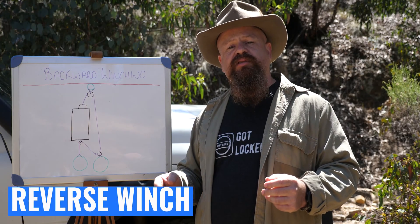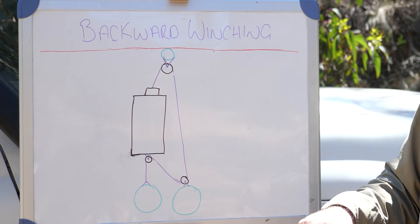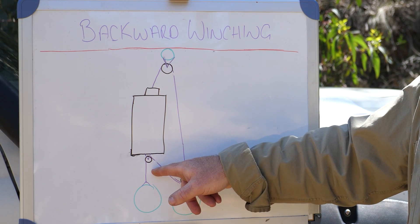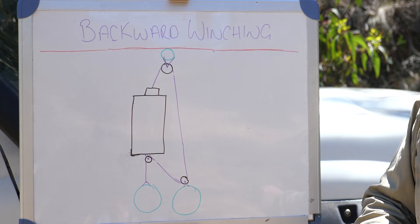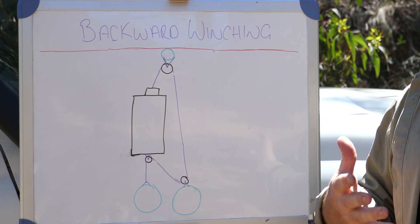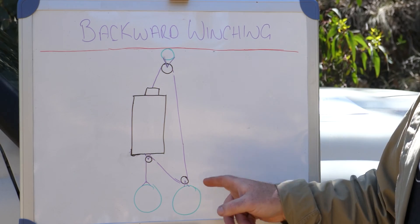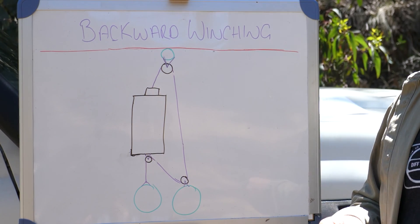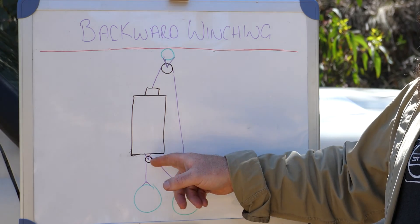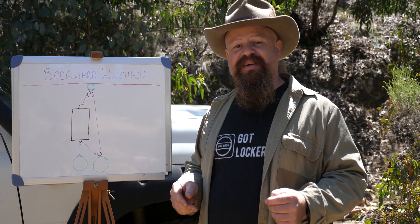The final scenario is backwards winching. We have a vehicle with a forward-mounted winch running up through a static snatch block, back down through a second static snatch block, then up through a snatch block mounted in the rear recovery point and back to a tree. The first static snatch block provides only redirection — mechanical advantage of one. The second static snatch block is also mechanical advantage of one, a Class 1 lever providing no mechanical advantage. However, the rear snatch block is a Class 2 lever providing a mechanical advantage of two, and therefore the line shortens and the vehicle travels backwards.